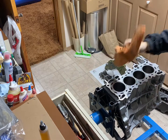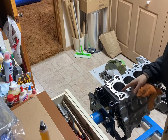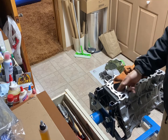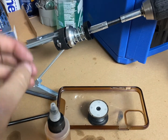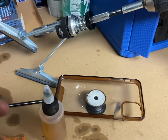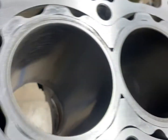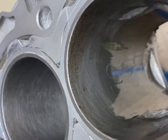Now grab a cloth, wipe it, and check your cylinder walls to see if there's any more rust or surface rust on the sides. Also, if you're wondering where I got this tool, I got it from Canadian Tire. You can find it at Harbor Freight for the Americans, or on Amazon. It was about $30. And it makes a nice cross-hatching pattern as you can see. There's no more surface rust, as in cylinder 2 — you can see there was some surface rust on the top there.